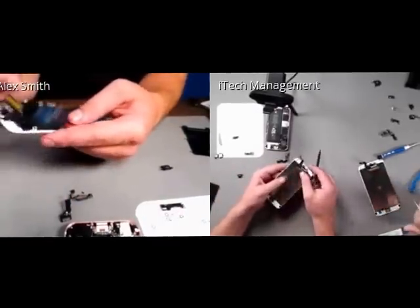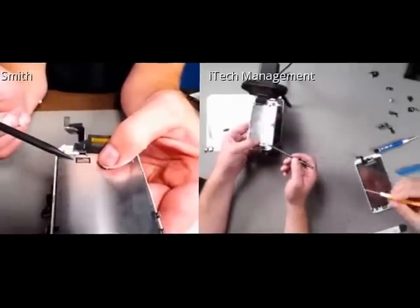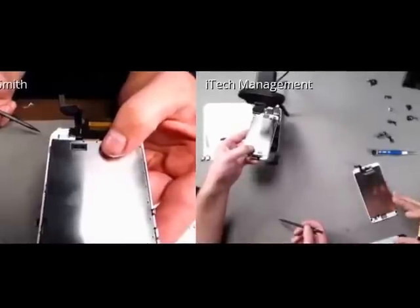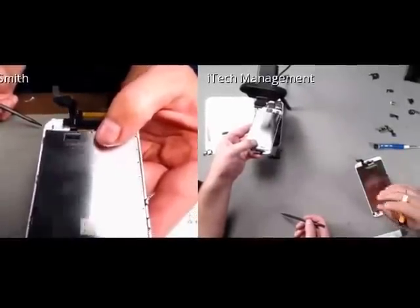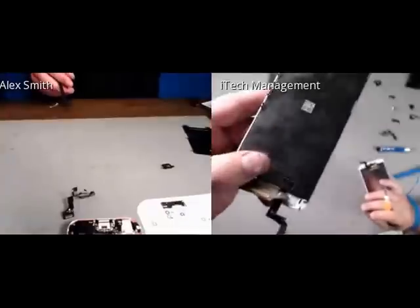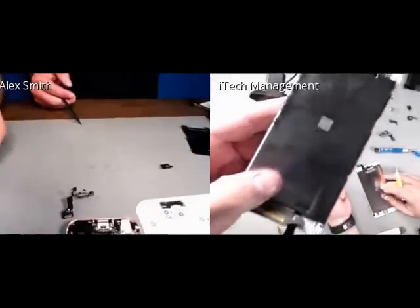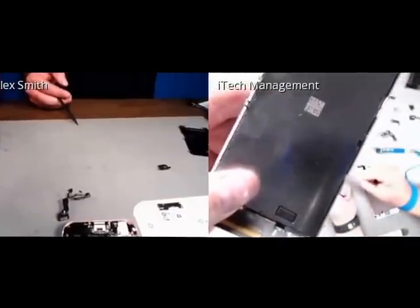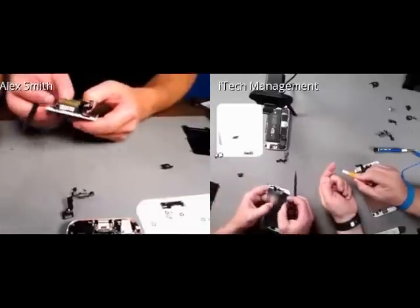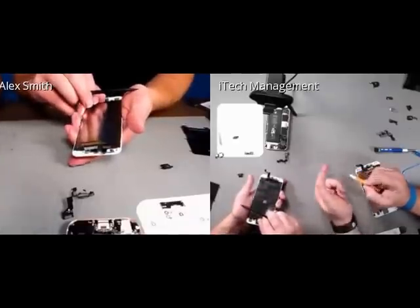But so I'll get back to Ed. But before I do, I think what we're most excited about is, Ed, do you want to explain what this is? So this is the controller for what they call 3D touch. Now, I know how Apple markets this, where people seem to think that the glass actually flexes, but the way it functions, there's a thin membrane down in between these plates here that senses a light touch or a heavy touch by the amount of the contact the skin's making. So when you do a light touch, you'll have a small dot, and the harder you press, of course, your fingerprint will become larger on the surface, and that tells it to switch into a different mode.